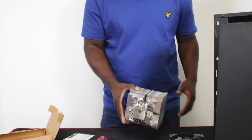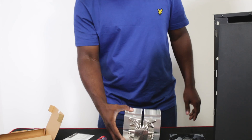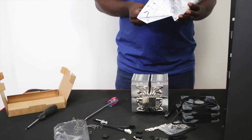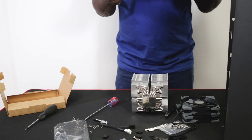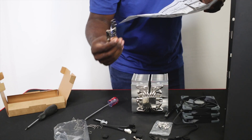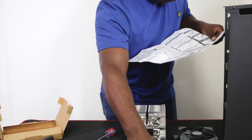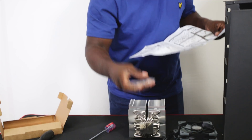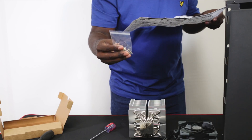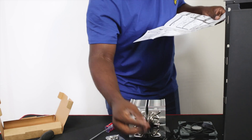A Threadripper would have a much bigger plate but then it wouldn't work with anything else. What they should do is let you change the plates so you can have one cooler that fits all, like this one. Looking at the instructions: the mounting clips are for 775, 1151, 1366, and 2066. The studs in the bottom are for the 2066, and what I'm using is the 6700K which is the 1151 socket - that'll go in with no problem.